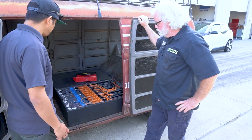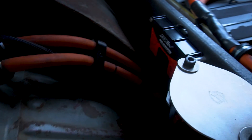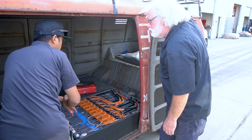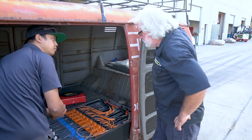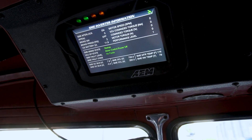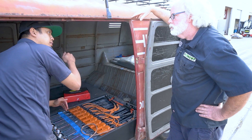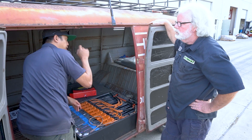Let's check out the BMS. So here we can see the VCU — we mounted the units on the back of the packs. Currently we're watching this single string of this battery module and then a single battery module on that side as well. So we have the master unit and there's a satellite unit. They're both communicating to each other through this wire, which is a serial connection. You can actually daisy chain multiple units. Right now we're only using two units and the VCU 200 can support up to six. Each unit has 18 cell taps, and this should be good for a typical 400-volt system. The previous setup had a maximum of 12 cell taps per monitoring unit, so an additional six cells per unit.